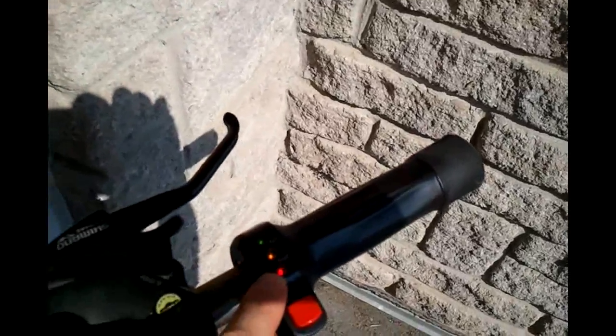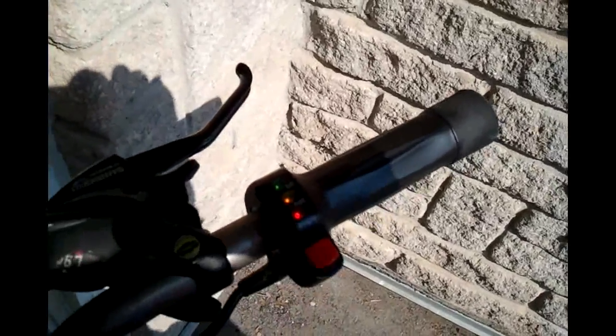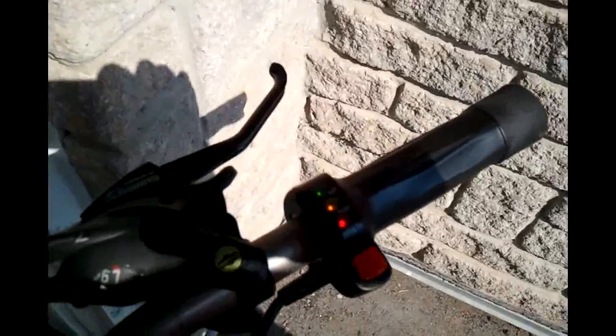Spokes have never even had to be tightened up or anything. The twist throttle has lights on there, although from what I've read and experienced, the lithium ion battery isn't compatible — or more like the throttle isn't made to be compatible with lithium ion batteries because they discharge at a different rate. So the lights will go down to red within minutes of riding instead of over time. But there is a fix on the GoldenMotor forum that explains how to make it work better with lithium ions using a variable resistor.